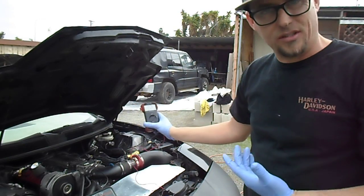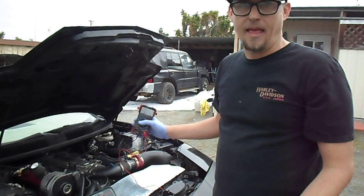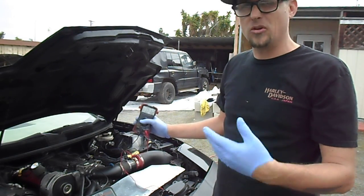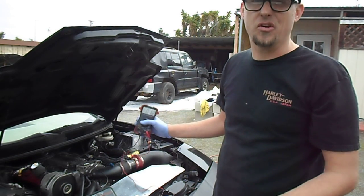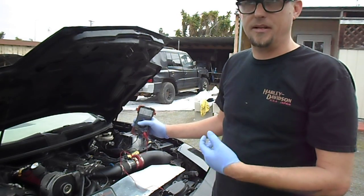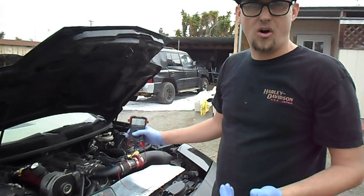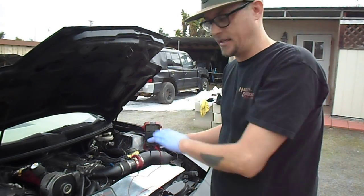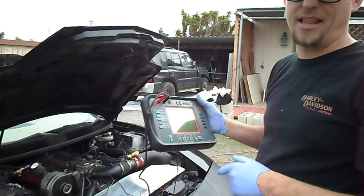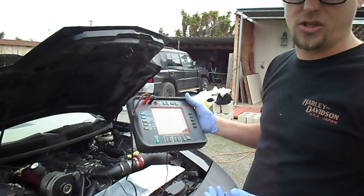This $25 auto-ranging digital multimeter from AutoZone is not going to show you the fallout — it'll only tell you if it's bad, not if it's good. If you see the signal go offline when you rev it up and it starts misfiring, you know you don't have a signal. But there's no way to prove the OptiSpark is good with a multimeter alone. The only way is with a lab scope, which is expensive but well worth it for such an old car.